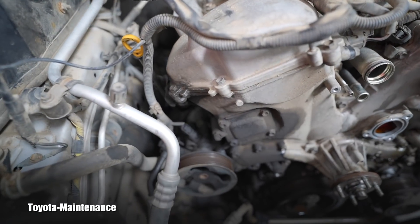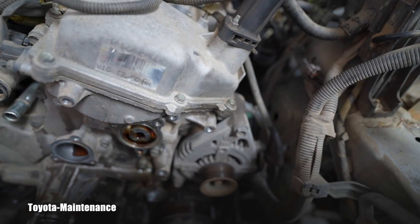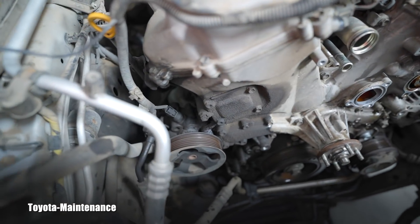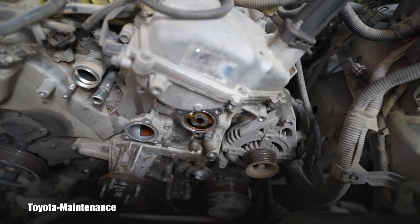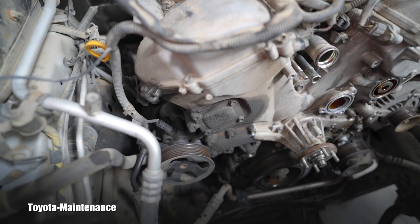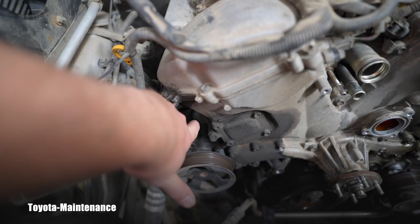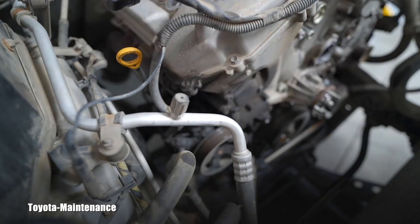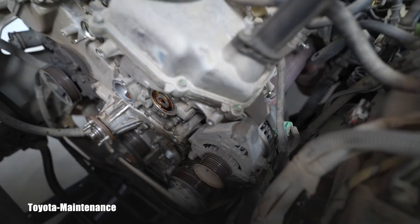We discussed this on the channel around 2010, 2011, 2012 — we were actually resealing this timing chain cover on this side. It was a recall, covered by warranty; Toyota was performing it for owners basically for free. You are not replacing that cover, just resealing it, because right here in this area the seal somehow failed — maybe the layer was too thin, or the robot didn't apply it correctly.